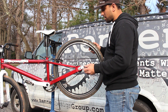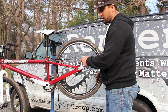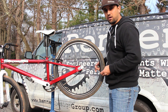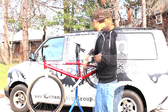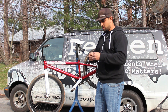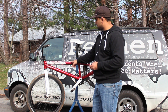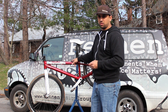Affixing the third magnet is exactly like what you did for the first and second magnets. Again, we position it on an inside spoke, count three spokes away — this is the location of the third magnet. This gives us assurance that all three magnets are going to be mounted at 120 degrees. Our last piece of hardware is the wiring harness. On our package description, we're showing that the head unit is mounted at the front of the bike, but what we're suggesting everyone mount their devices is about five to six inches away from the seat post. That seems to stay away from most people's pedaling characteristics and popping the units off isn't really an issue anymore.